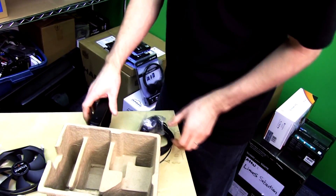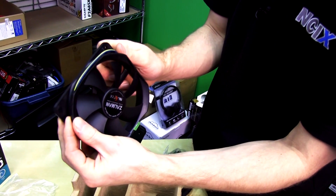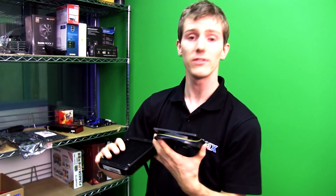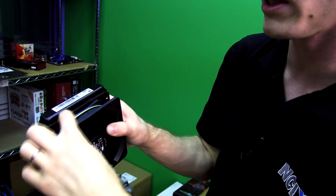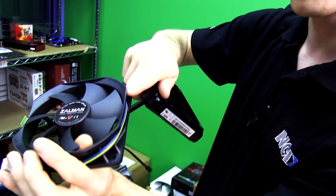There's also an Intel hold-down swappable piece, AMD hold-down, AMD backplate, and LGA 2011 is done a slightly different way. Next up is the fan itself. I personally wish they'd gone with a different style fan — there are only mounting holes on one side, which gives a cleaner look and decreases potential interference around the back 120 millimeter slot. However, it does not give me the option to put the fan on the other side for optimal cooling. It is a PWM fan though, which is better than what most people include with pre-done water cooling kits, so at least it'll run very quiet.